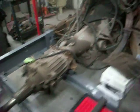The last video I wanted to put the torsion bars in, but I had forgotten that I wanted to put the lower control arm bushings in first. That's why I didn't put the torsion bars in yet. While I was doing the shock absorbers today, I noticed this one side here was pretty rusted — the shock mount. So I replaced that. I cut out a pattern, replaced it, and welded it in. So when it comes time I'll be able to just put the shocks onto those. But I still need to take the control arms down to replace the bushings.